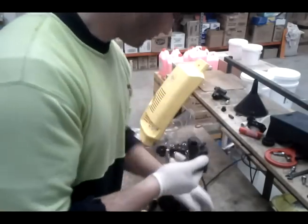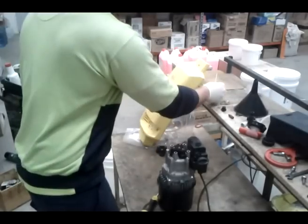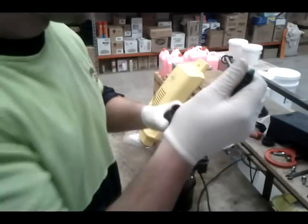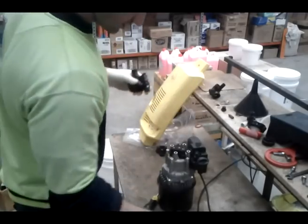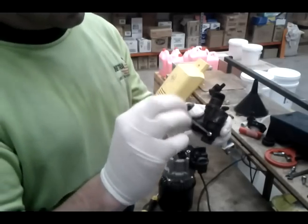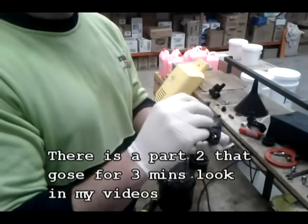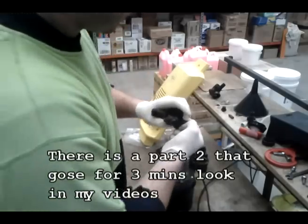Next stage, you can't forget, when swapping over to the new cylinder head, that's this one here, this little rubber in here. There's a little rubber in here that you must remove. Be very careful that you don't wreck it. And there it is. You need that. If you don't put it in, you're going to be leaking, have the same issues as before. Next, remove the key little hex screw here. There's a little screw on the back of it. You got to watch it, you don't lose that either. And coming to this, you got to be careful you don't lose a lot of little pieces. Okay, pop that out, screws out, put that up here.